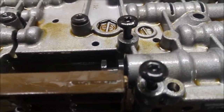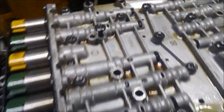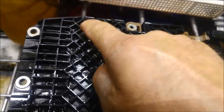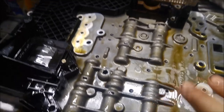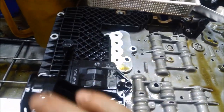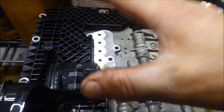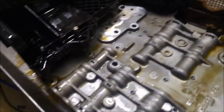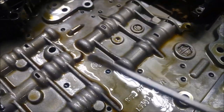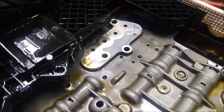I'll show you again which six bolts to remove. Flip the valve body over and you can actually see the bolt locations from the other side. Now we just carefully wriggle the mechatronic part off the solenoids without generating any static. If the mechatronics haven't been off for a while, they'll be stuck on the two locating pins. Use a little bent screwdriver and lever it up slightly and evenly — it has to come off evenly off those two pins and off the solenoids.